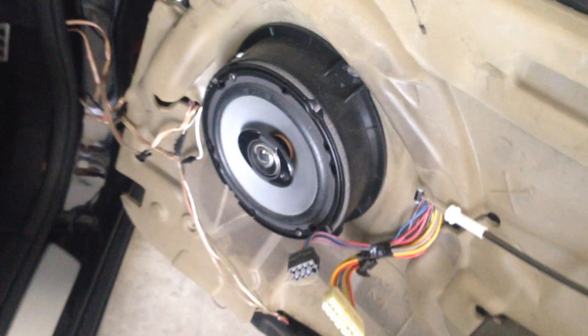Almost done. The only thing left is to actually ground the amplifier. A good place I've found is a ground point right here in the boot — I pulled the bolt out, got my own bolt and washer with a nut on the other side, and wired all my amps into that. Make sure they've all got good terminals so they're held in place nice and tight. It's really easy to get to and easy to do — just run your earth from your amplifier to that point.